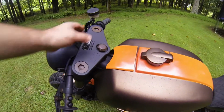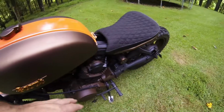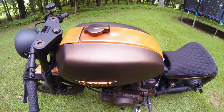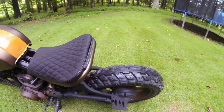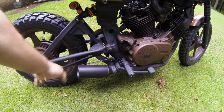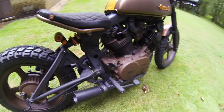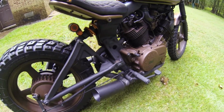The top trees, custom. We milled it by hand. Everything we've milled by hand here. So the foot pegs, air intake, the tree, all made in-house. Not a lot of stuff on this bike had to go outside of in-house. We did the exhaust in-house. It's got stainless steel wool packing, so the packing will last you longer than what a fiberglass would. We had Tough Side cover our seat. This is a tweed. We love this tweed material.